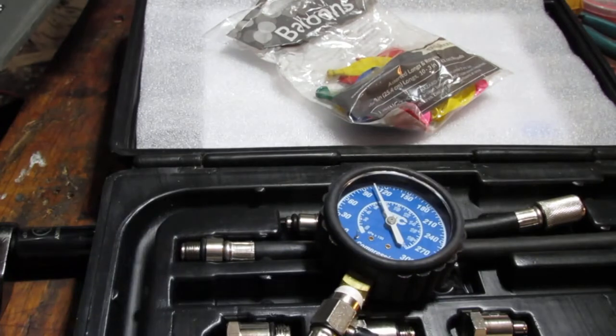Okay. Alright. So, we have pressure in the engine cylinder. We have spark. It's an old spark plug. We have fuel. The engine can breathe. Muffler's not clogged. I'm just thinking out loud. I don't know. I'm thinking spark plug. Maybe the spark plug is not giving enough spark.